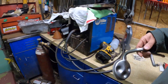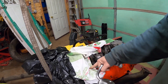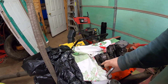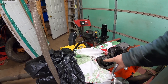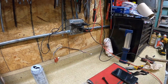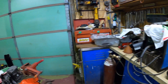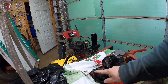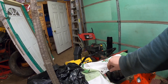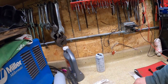The pickup — we've done a little modification to it already. The pickup goes in there and it's supposed to bolt right down here. On Novas they have a hole already threaded so you can do that, or you can buy this bolt, or you can make your own. I just chose to buy it for $15. This new bolt has a nut welded onto the top of it already, so you torque that down and then put the oil pickup in there.